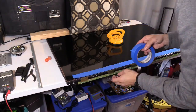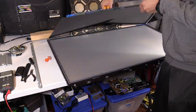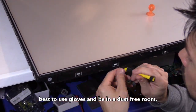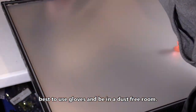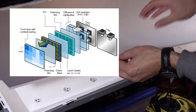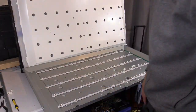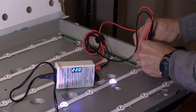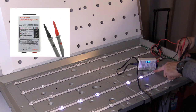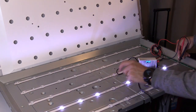Then we're going to take off the LCD panel. The buffer boards are hardwired to the LCD panel — do not tear the ribbon cable connections, they're really sensitive. We use a suction cup to lift that up, and under that is layers of films. We're going to pop the clips to get access to these films, and then we'll get access to the LED strips. From that point we're going to use a backlight LED tester to test the backlights — I'll leave a link in the video description below.